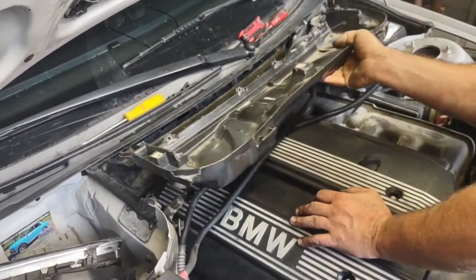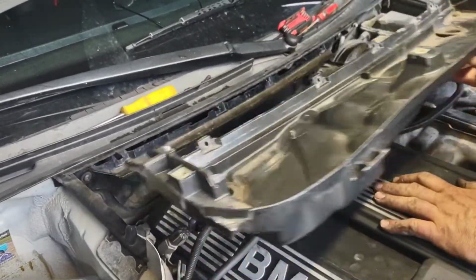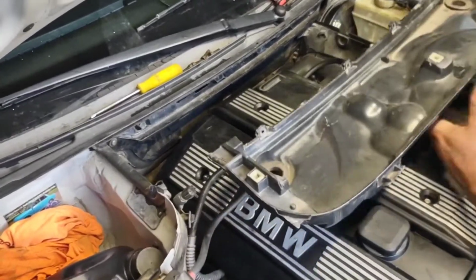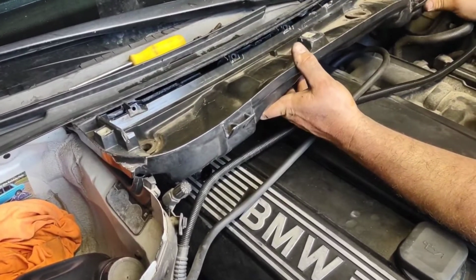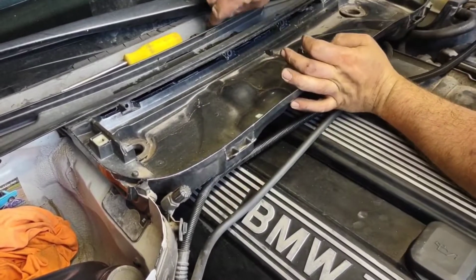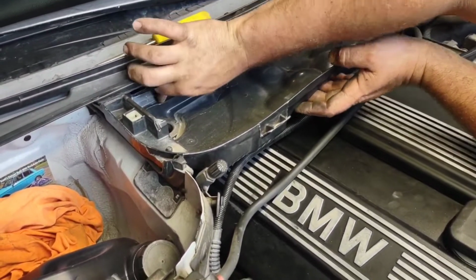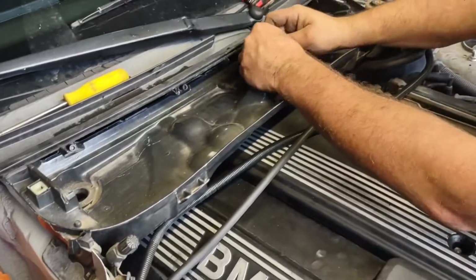Cabin air pan. In here. There's gaskets on top on either side. There's a gasket over here, supposed to be one over here. All right, now we're gonna put the cabin air filter tray in. This is like the drip tray from the cowl up here. It has a drain hose. Let me make sure that's not obstructed. It doesn't normally get obstructed, but if a car's maybe sitting somewhere for a long time, it can. I'll put these four bolts in back through here. Let's clasp this tray together so that the car can pull clean, fresh air out once you put the filter in.